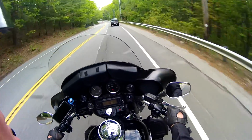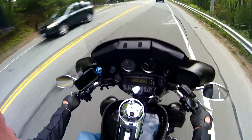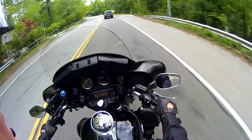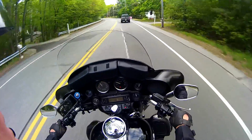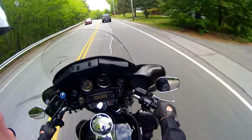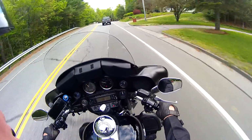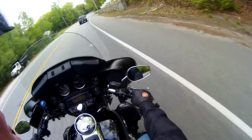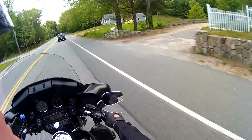But to really get them to run right, to get your money's worth out of this V-twin, you got to put an air cleaner on it. You got to take that restrictive air box off. You got to put headers on it, and a decent performance set of mufflers on them to get them to run right. And then you got to put a tuner on it, so there's just no getting around it.